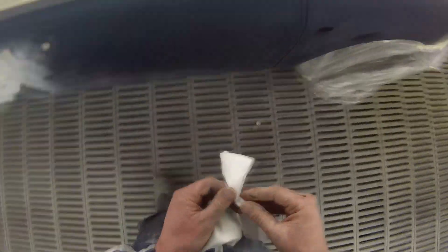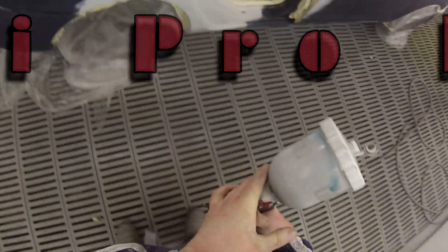The areas that I'm just going to be putting my clear coat and blending my colour through, I'm wiping down first. This is mainly because I do dry sanding techniques. One of the things with dry sanding is you've got to be careful of the dust from the primer, because we haven't had any liquids in that primer yet to pull the dust out. If you wipe over that primer area first and then wipe over your blend area, you can actually be left with a milky haze over the blend — that's the dust from the primer. Trust me, I know this because it's happened to me before.